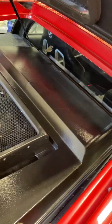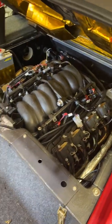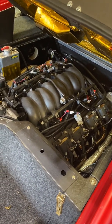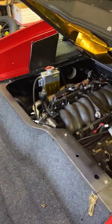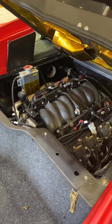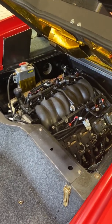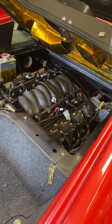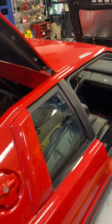Let's raise it up and take a peek, because yours isn't as busy as mine — this is how you do it correctly. There's AC right there. LS1 out of a 99 Z28 or Camaro SS. It's just got a cam and shorty headers, and it's running Terminator X with a flex fuel sensor so you can run E85. You can see a lot of similarities because I stole every one of his ideas — he's an engineer, and you can see the lack of wiring harness everywhere because he does things correctly.